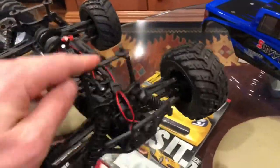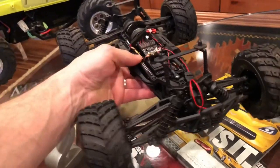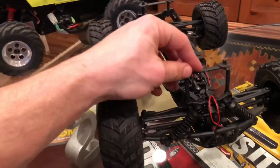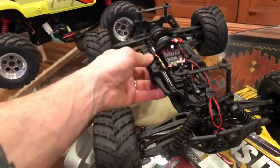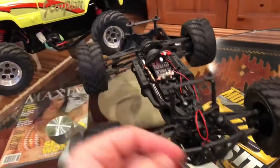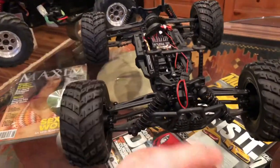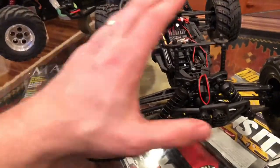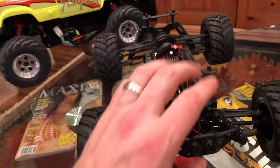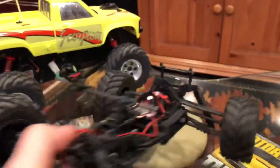After driving this thing, here's what I've noticed. The shocks are pretty springy — they are definitely not oil-filled, as I mentioned earlier. I might want to think about getting something with a little bit stiffer suspension, because it seems like it almost bottoms out pretty easily off a high jump. I did try it in snow and it seemed a little bit low — the slushy type of snow just caused it to get stuck and sink. There is one more suspension position I'm going to try to give it a little bit more height.